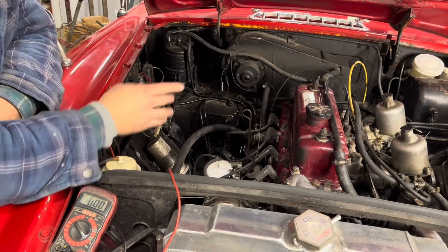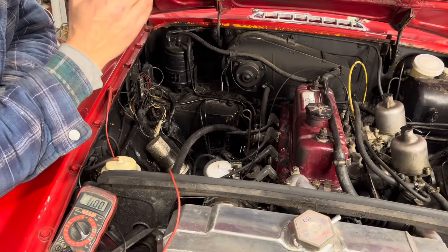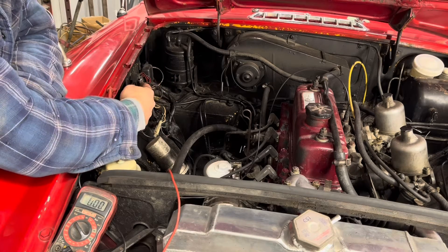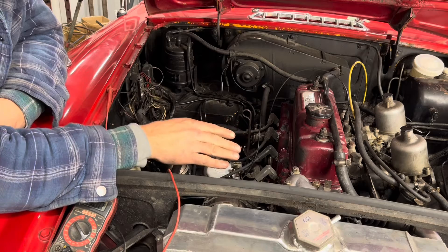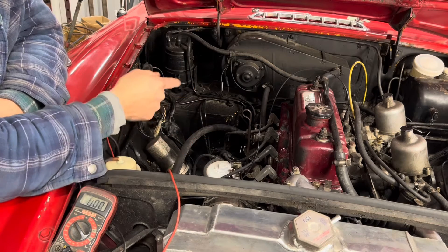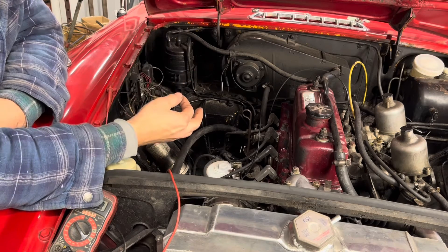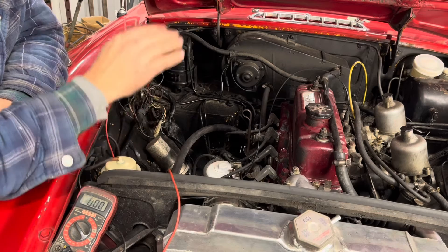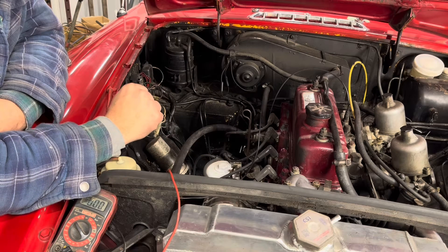Normally we want to check for voltage at the battery. Now it's not always so easy to do, especially with a GT because you got to take the whole rear seat out to get to it. But one of the easy ways to do it if you don't want to get to the battery is you can check it right here at the fuse box. What we're looking for when it's running is a minimum of 13.8 volts — it'll be around 13.8 to 14.2. Once it's showing pretty good, then you want to turn the lights on and other equipment, maybe the headlights, blower motor, whatever, and see if it drops. If it drops down below 13.8, then the alternator is not really putting out enough.